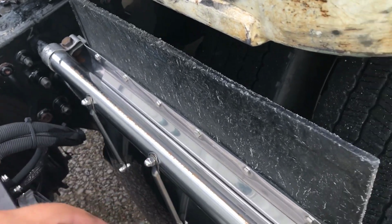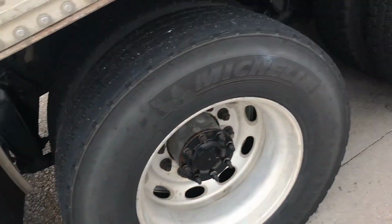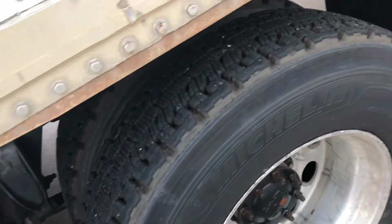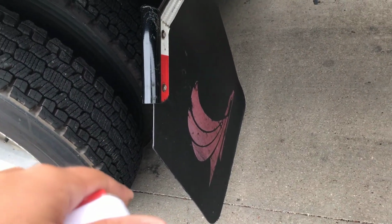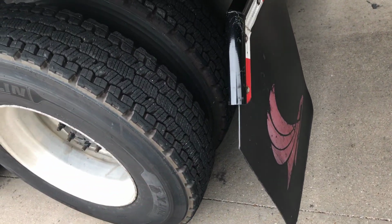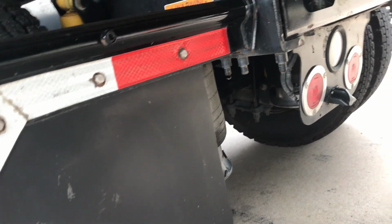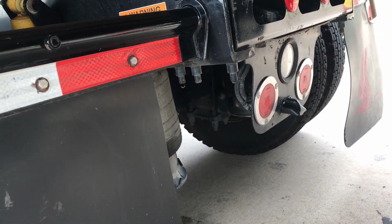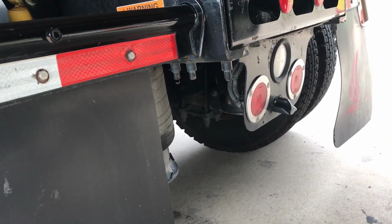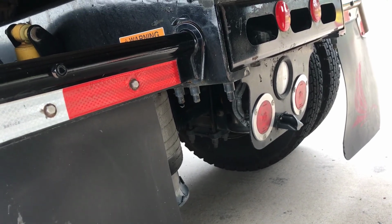are not leaking. Splash guards, and mud flaps not damaged and mounted securely. Tail lights and reflectors are clean, functional, and red in color. Left and right red turn signals, clean and functional. Four-way flashers, brake lights, red and functioning. Backing light, clean and functional.